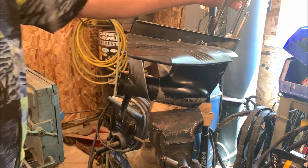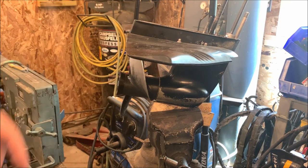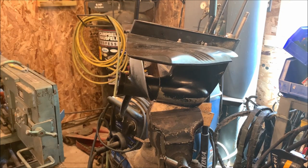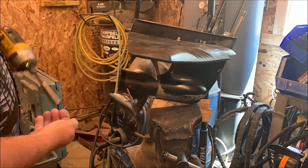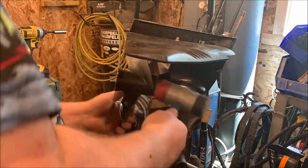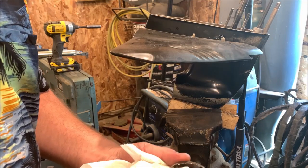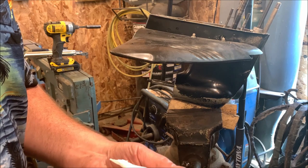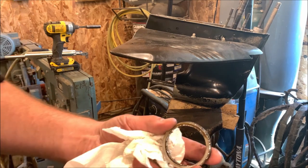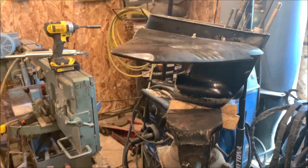So we're going to pull it apart. Plus I can't get it to do anything but stay in forward gear. We're going to pull the prop off and then see how to get the rest of it apart. We got the plastic lock nut — feels like plastic anyway — plus a spacer washer behind it pulled out. Now we've got to pull out the next piece; let me bring you around here to show you what we've got.